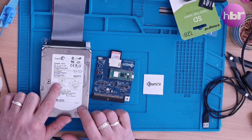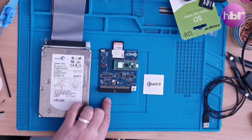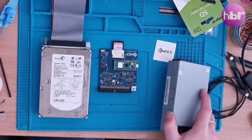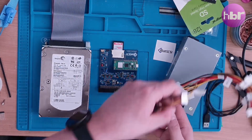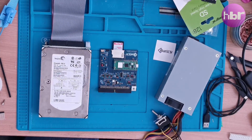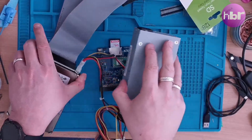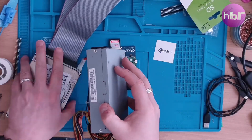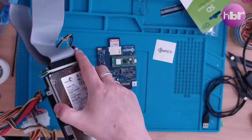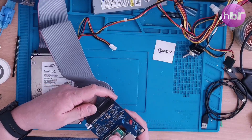It's a 73 GB drive, so I had to find a 128 GB SD card. The aim here is to use the Blue SCSI in its initiator mode to image this drive. To do that we're going to need some power. I've got this hooked up to my Tandell adapter which has a nice handy on-off switch on it, and we're going to use that to power up the SCSI drive. Let's try and get this neatly arranged and put these two on the same SCSI bus.